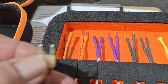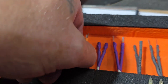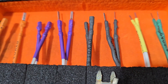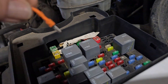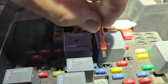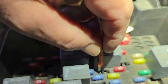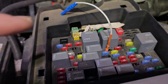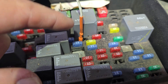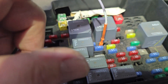We're going to come over to the forward probe kit and find the forward probes that are the same as this fuse. This orange one looks the same. We're going to plug this into the front fuse connection. The reason you want a forward probe is because if you use the wrong terminal and push it in here, you will open the contacts in the fuse box — then when you plug your fuse in, you'll have no contact or intermittent contact, and it's something you created.